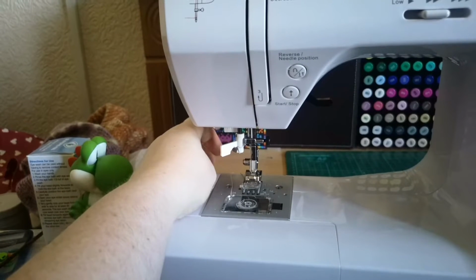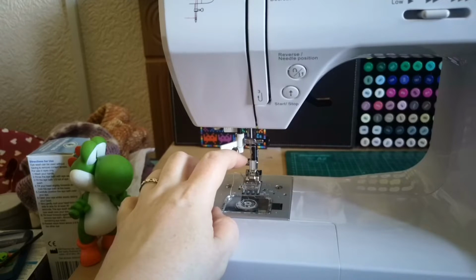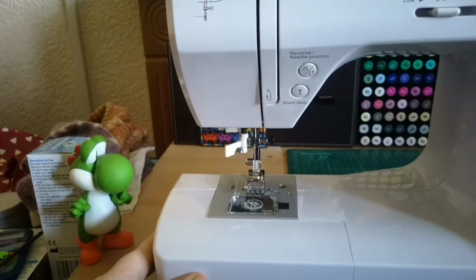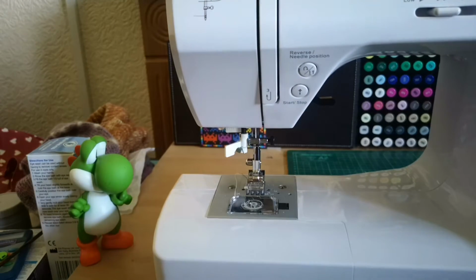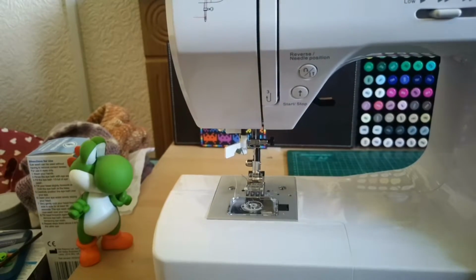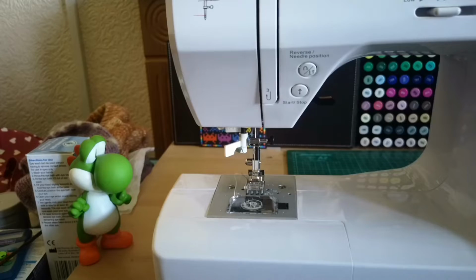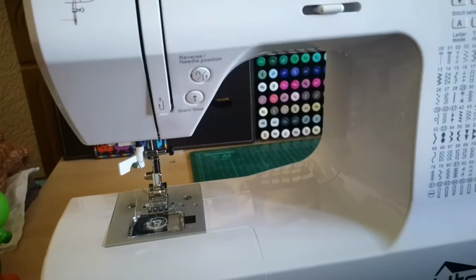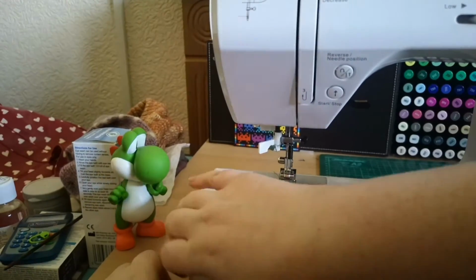That's very important because you need that tension. If you don't do that, that's a reason why the yellow might be coming up. So that's giving the correct tension there for both of the threads at the exact same time. That important step there is to hold both of the two threads. Now I've done it in two different colours. I should have done something other than white. But keep hold of them at the back. And hopefully, that will be what's missing.